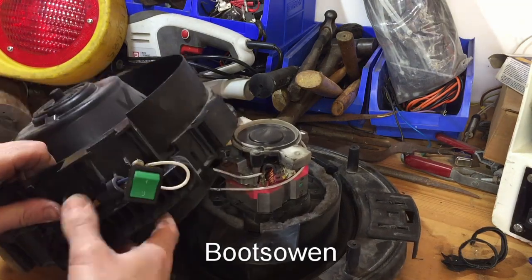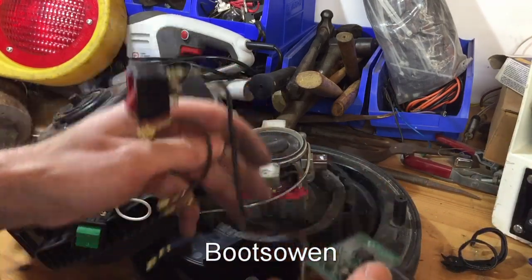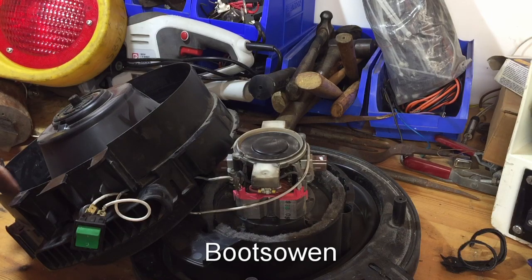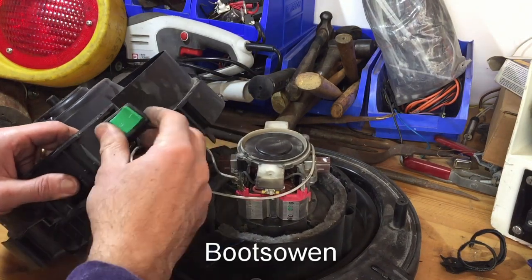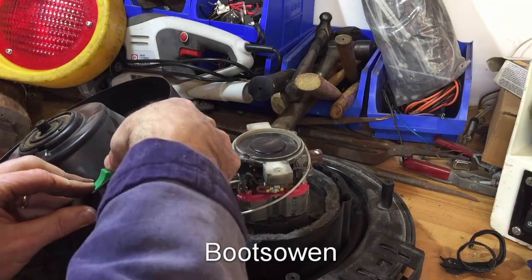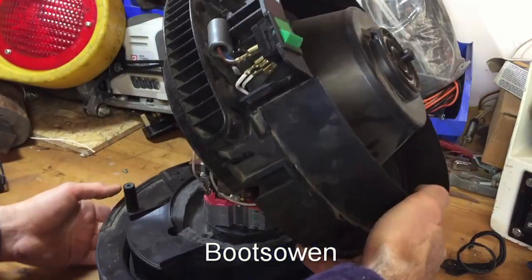So what can I remove out of here? Well, I can remove all of this — this is all of the high-low switch and control board and the associated wiring. I don't need to put that back in. What I could do is put this switch in instead of a blanking plate, but I'm not sure there's any need because if you want to get your finger in there there'll be nothing behind it. So let's see if I can push this all together again. Just snap it into position, pull this white cable through a bit, and then this would sit up on top.